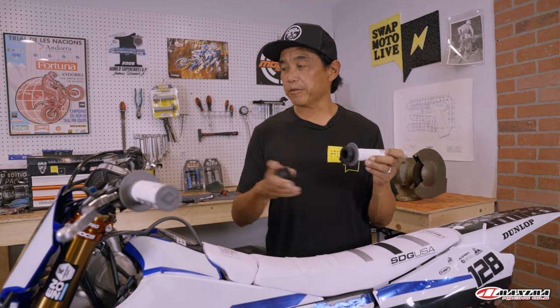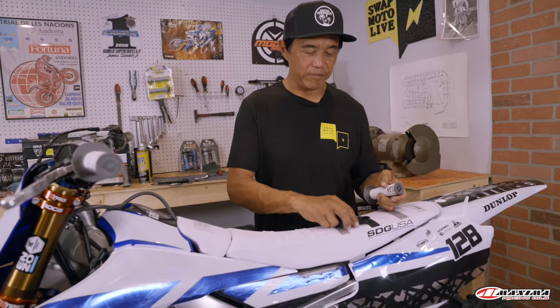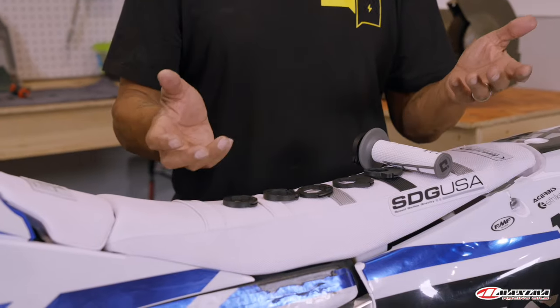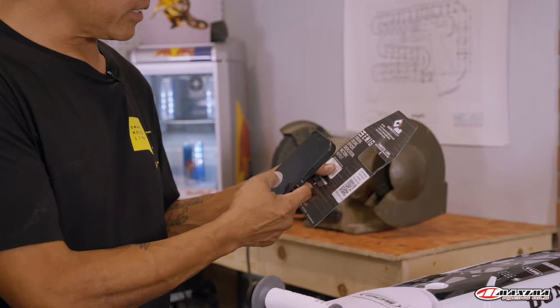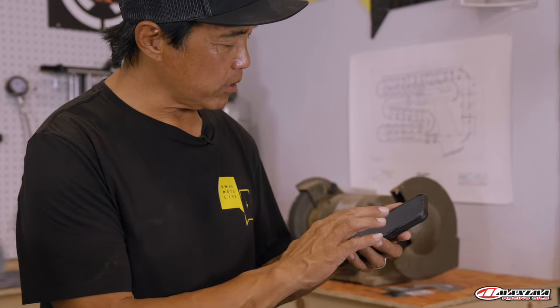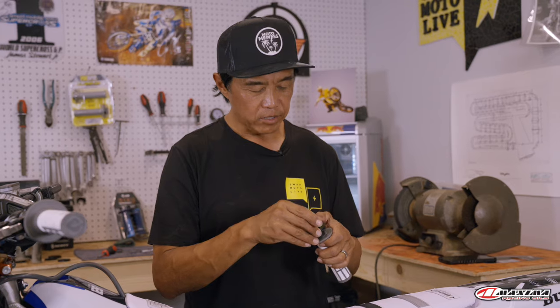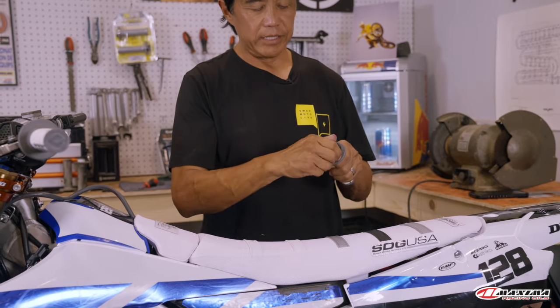The tricky part is the throttle side, because the grip comes on a throttle housing that we're going to install into the stock throttle assembly. We have a big assortment of throttle cams, so you need to figure out which one is right for your bike. ODI makes it easy — assuming everyone has a smartphone, there's a QR code you scan and the information comes up. We're looking for Yamaha, and from the online directory we know we need cam letter J. Put it on the throttle tube and push it on — it will snap into place securely. Give it a little jiggle to make sure it's on there.